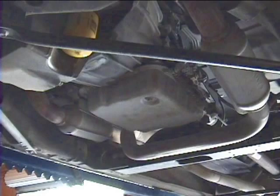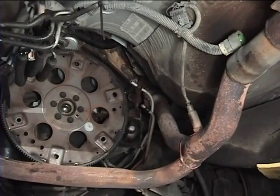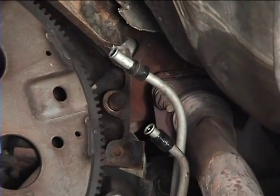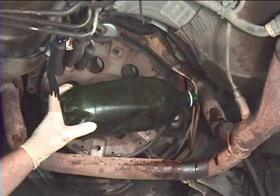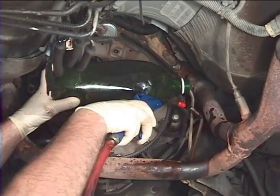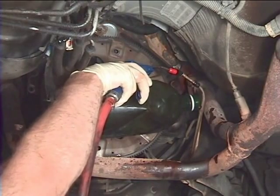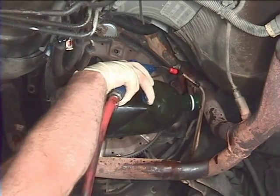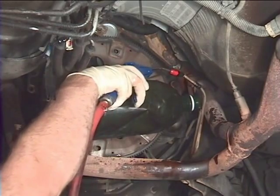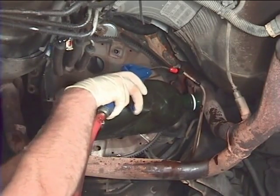Except for the installation part. Before installing the transmission in the vehicle, do your valve body a favor and remove the trash from the trans cooling system. Using a catch container, push air through both cooler lines, removing the old fluid. After the fluid is exhausted from the cooling system, the air should move freely. If not, then the system is restricted and the radiator will need to be replaced.